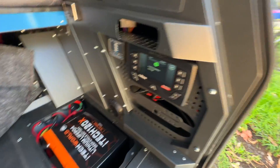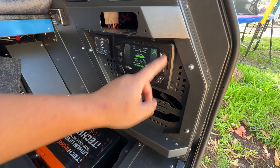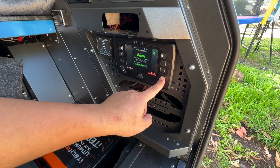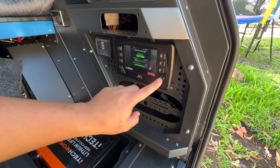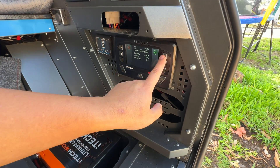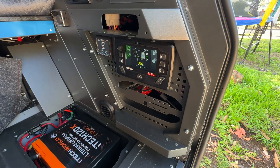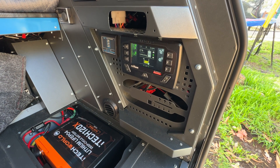I'm going to install a second one in this compartment here. It already comes with all the wiring, so I don't really need to do anything but to configure it — we're going to tell it that we now have a lithium battery. Once I have both in, I'll technically have 210 amp hours and we can go to the maximum current that this system supports: lithium, 210 amp hours. It'll calibrate the new battery percentage once it does a full charge, and I'll recharge everything once we've got both batteries in.